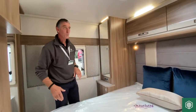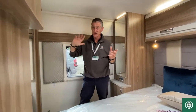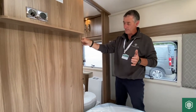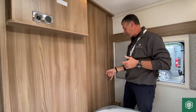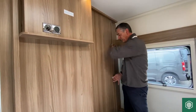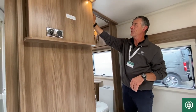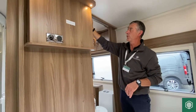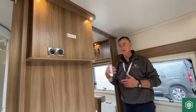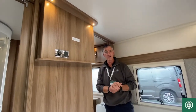These are some of the features in this particular vehicle. I'll talk about the sliding doors, which are quite nice. First, they have a little catch which holds the door back, and as you draw it across there's another catch that holds it in place — a double catch, top and bottom, for open or closed position. When in transit, you must put the transit catch in place, which is a shooting bolt that goes up into the frame and stops the door from moving while travelling.